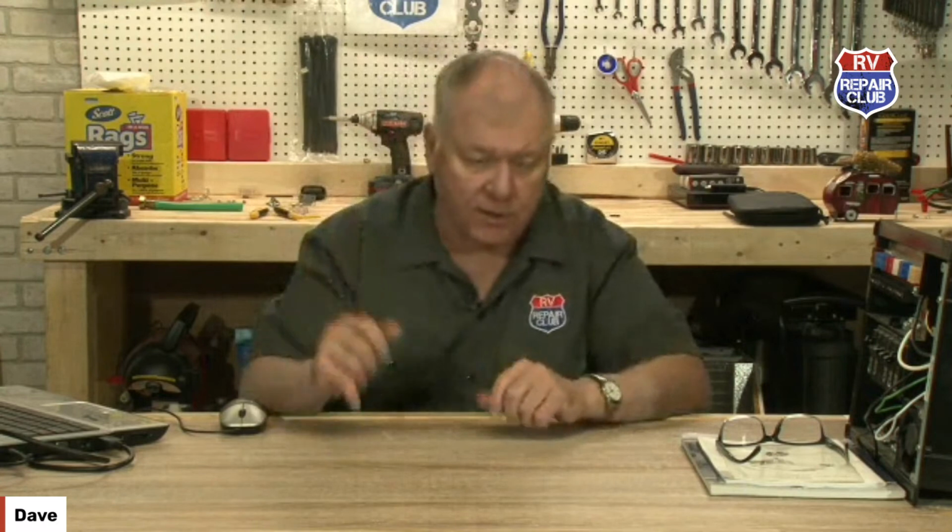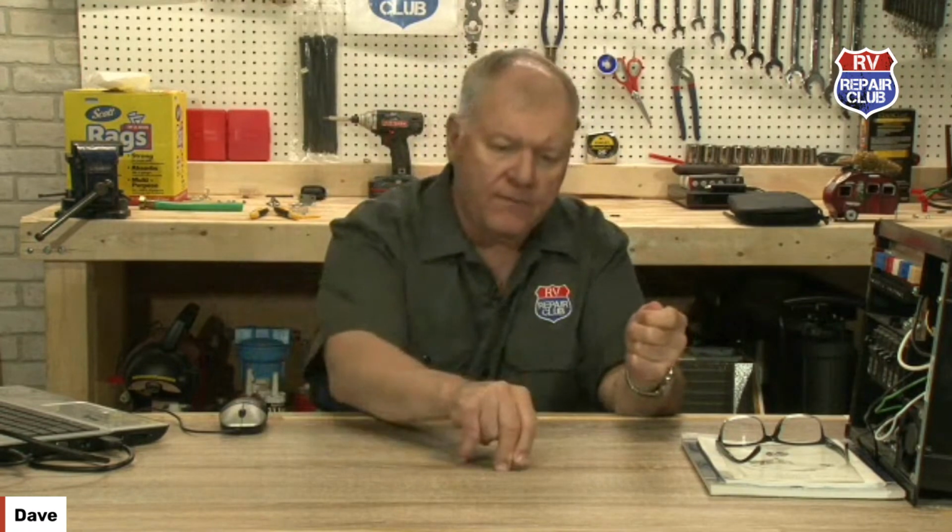The way you can tell is if you take a multimeter or just a simple little 12-volt light tester, and you pull the negative battery cable off and you put one end of the light tester on the negative cable and the needle on the light meter on your negative post, if it lights up, then you've got draw coming out of that. You don't know how much. You can tell that if you're using the multimeter, but it'll draw about 1 amp, 1.5 amps in that.